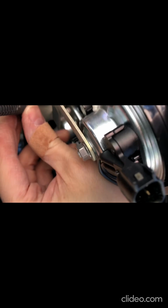All right, so the new horn is in there. I think the other one might have actually sustained some damage and gotten bent back, and that's why I had a hard time with the clearance, because this one I had a lot easier time getting just a 10 millimeter extension in there to tighten it up. So the last thing we're going to do here, just make sure you put the wiring harness back on properly. So you can just push that clip right in there. You'll hear it clip, and you're all set. It works great, and if you have to do this yourself, good luck.